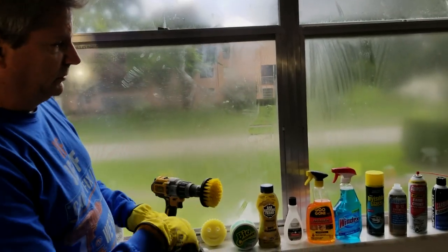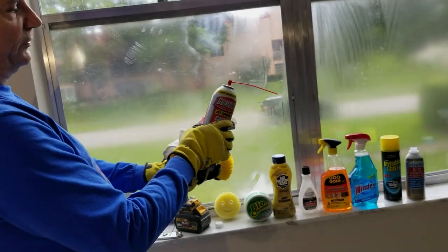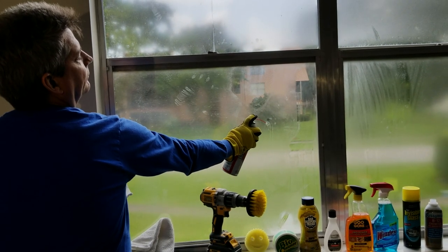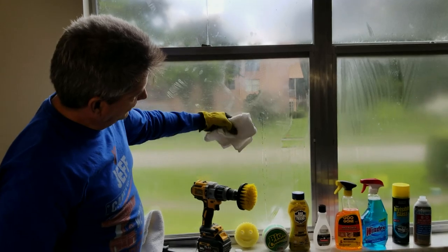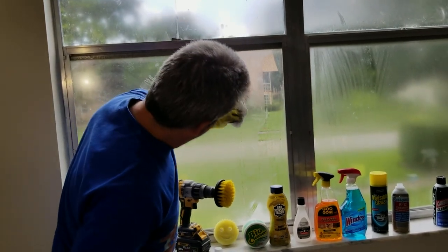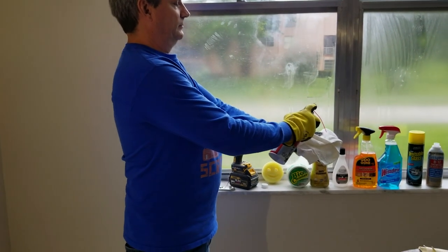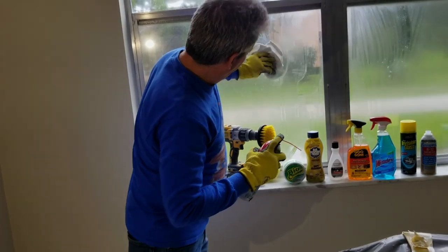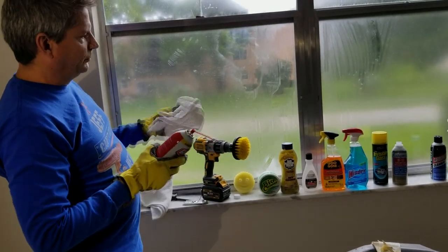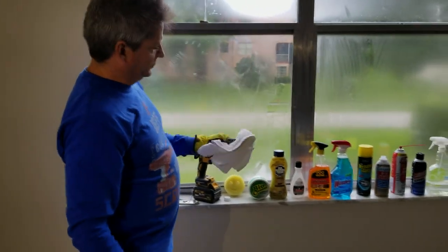Right off the bat we know the B12 is a pretty good solution. Next, Gum Out should be similar. If you're spraying anything, make sure you're wearing safety goggles. Notice how it gets really clear as it runs down the glass — that tells me Gum Out is going to be a pretty good solution too. Applying it directly onto the cloth and rubbing it around, you can see it's doing a job. It didn't quite seem as good as the B12, but it looks pretty close. So if you can't find the B12, the Gum Out will certainly get you started.